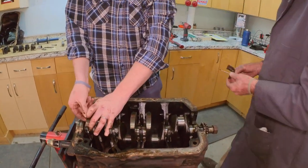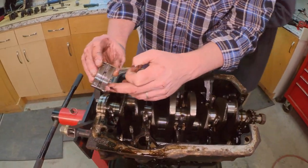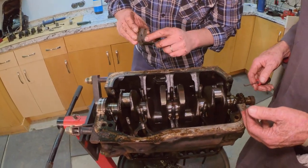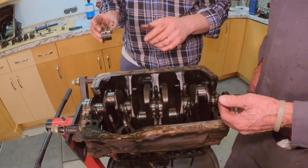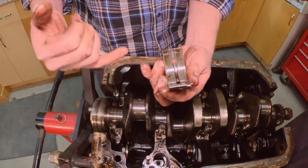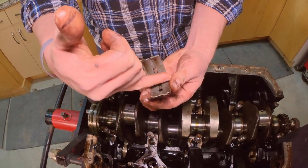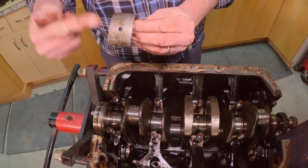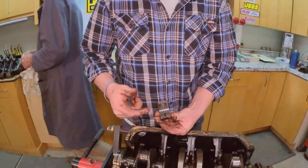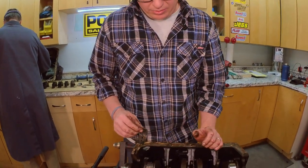That one right there too, same thing. Let's get down to Babbitt. But not really. It's not like trash went through it, and it's not hammered. Usually, if it were hammered, like the engine was loose or run kind of hard, you'd see the marks right vertical with the piston, where the load is the most, because that's when combustion happens and puts the load on it. You'll see that in the rods too.